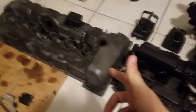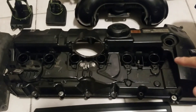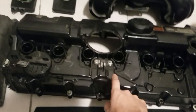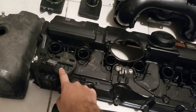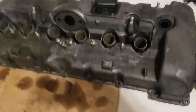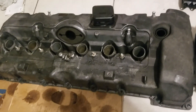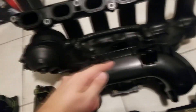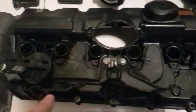With the M52 engine or a 325i with the metal valve cover versus the plastic valve cover: the 328i plastic valve cover has an oil separator as well as the PCV integrated into the cover. The 325i with the metal valve cover won't have any of that inside the valve cover — everything is on the outside. The 325i will have PCV and oil separator attached to the manifold, so there is a hose that goes from that end of the manifold all the way to the oil separator and then into the manifold. In the 328i, all that is in the cover, so the hose goes straight from there into the manifold.